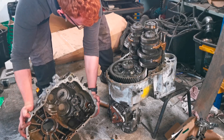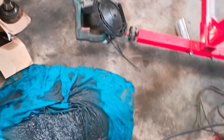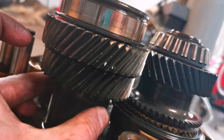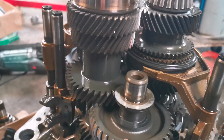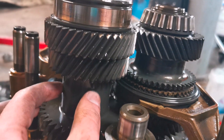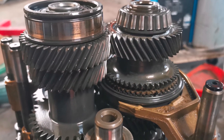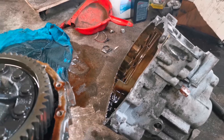The reason I have to split this is because I need to put a brass insert in here, which will put pressure on this to hold it in position. Because of the amount of torque going through these gears, the gearbox can't take it — so it's basically just a brass support that sits in here, you tighten it up and it'll hold that in position. I'll just have to wait until I get the gearbox out and I can start modifying it.